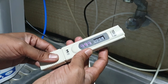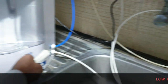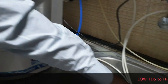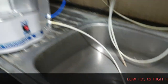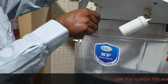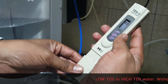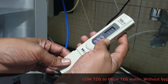Now if you want, I will show you the live demo of how it converts back to RO. I will press this button — now you are going to get RO water. You can see the reject water in RO is doubled now, and RO water flow will be less. It will not immediately give the low TDS we saw earlier — it will take some time. Currently it is showing 475 because there is still nano filter water in the pipeline.